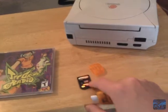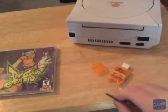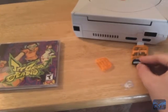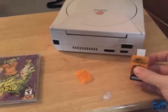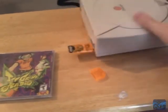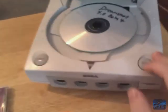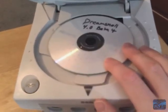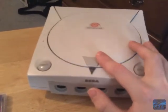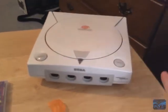Basically, all you need to do is put the games you want onto the SD card, place the SD card into the adapter like so, and place it into the serial port here. Once you do that, you will need one more thing, and that would be DreamShell 4.0 Beta 4. DreamShell will allow you to boot the games from the SD card. Otherwise, you just boot up your Dreamcast, it'll just act like normal, and nothing will happen.